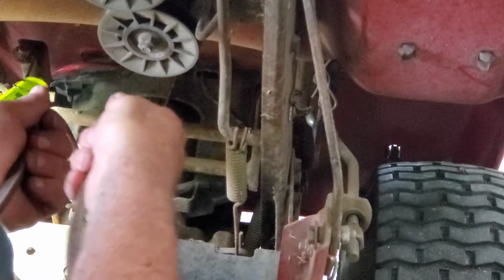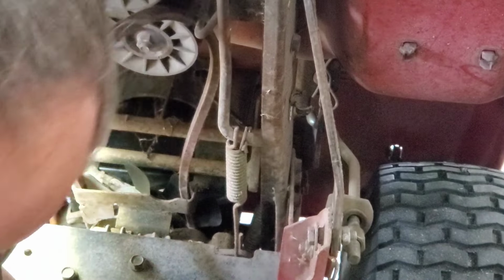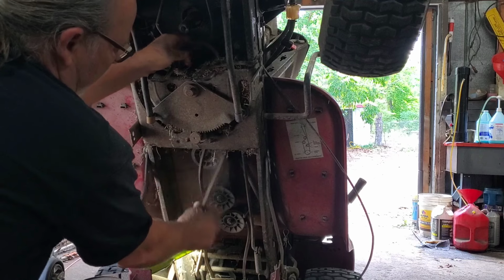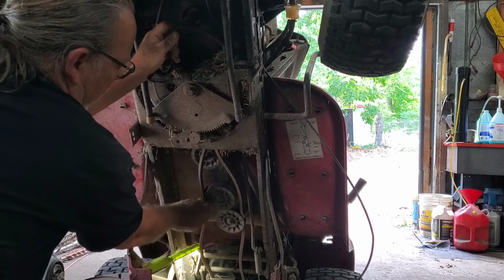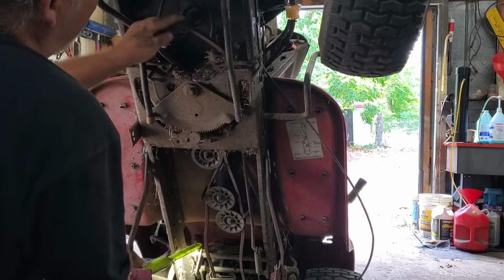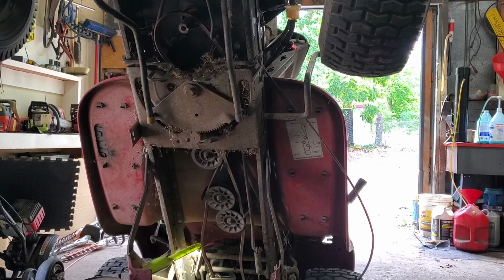All right, we are on the pulley. We're gonna walk this one back on. Boom, just like that. Now we're gonna grab our belt, feed it up through here. There it comes out the top. Now what we want to do, put this one right behind that keeper, this one right behind that keeper, and now we're up to the crankshaft. It's just too doggone easy.